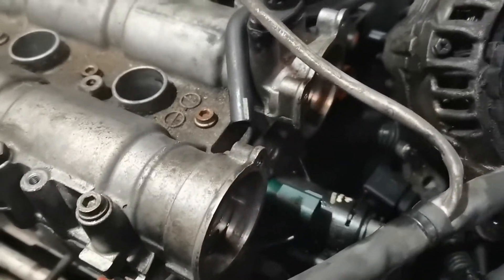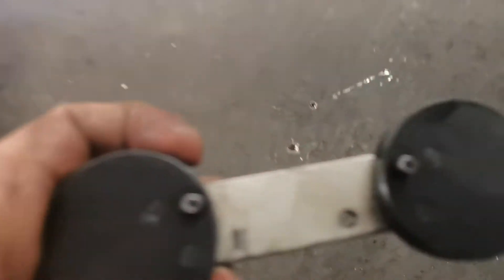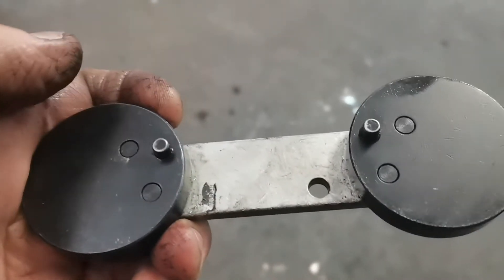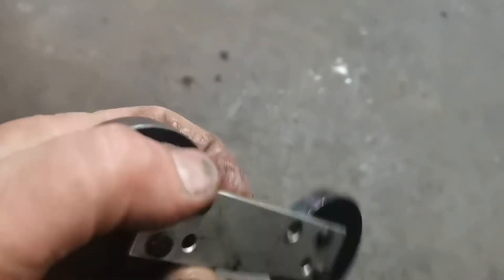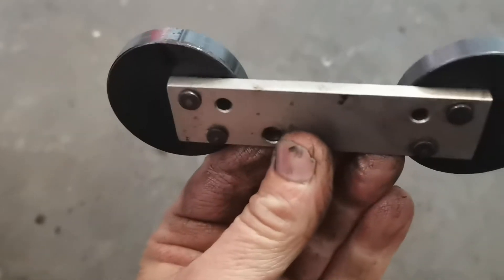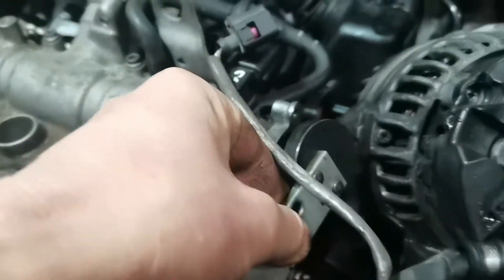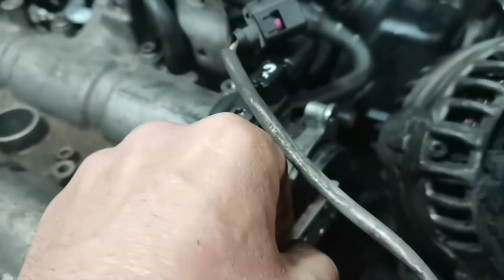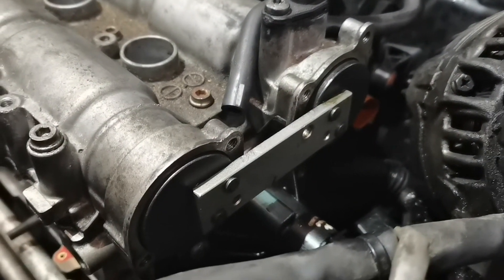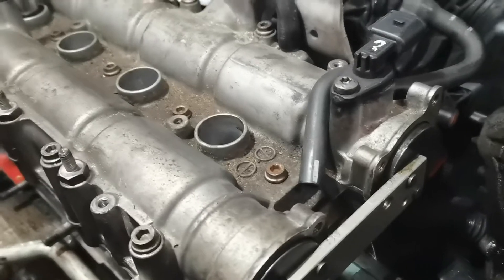For the cams, there's a special tool for this engine. On the tool there are two pieces of metal that go into holes — two dowels that locate into holes in the cams. This piece here, if oriented the wrong way, won't work. It needs to be that way up for TDC, and then it locates in the back of the cam carrier like so, pushed completely in until the dowels locate in the holes in the cams.